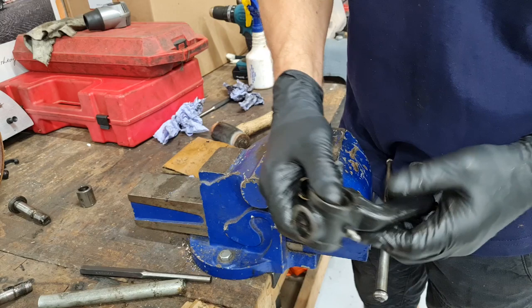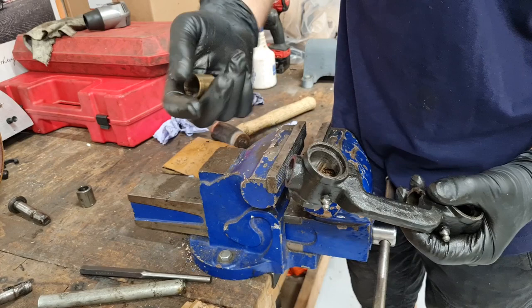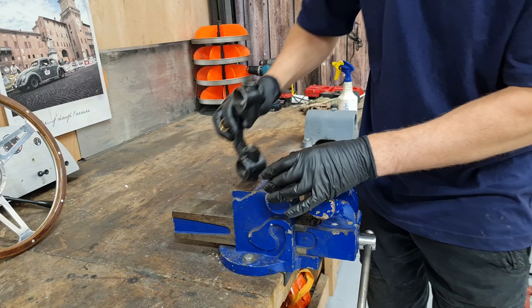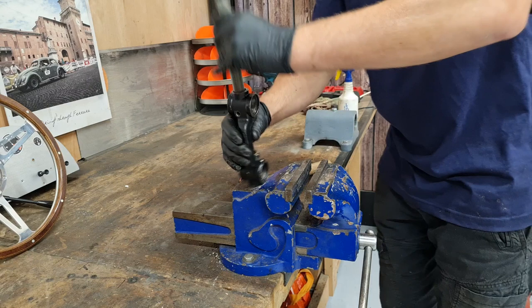That's our bushes removed. We'll give these another good clean up, make sure we've got good faces and haven't done any damage — which we haven't. Make sure they're all nice and clean, take our grease nipples out and clean through there as well. We don't want to be pumping grease in and moving debris around our new bushes. Ready to fit our brand new king pin bush into the thrust face side — using the solid part of the vice we're just going to drift it down until it's flush, using our little bit of tube that's the right diameter. Just going to gently tap it into place.